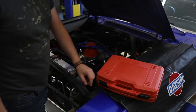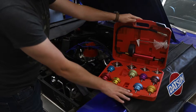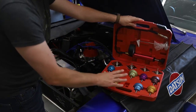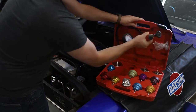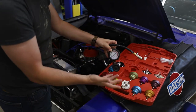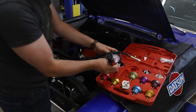Let's crack into this pressure test kit and see what we're working with. The pressure testing kit I have here is a generic Amazon testing kit — some Chinese kit that's sold under multiple names. It has many different adapters for different cooling systems. In my particular case, I'll probably just need this standard sized radiator cap replacement item and the pressure tester. The pressure tester is basically just a glorified bicycle pump with a gauge on it, and this will allow us to put a few pounds of pressure into the system and begin to test whether or not there's a leak.